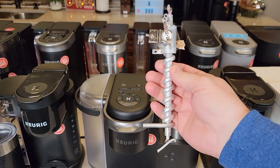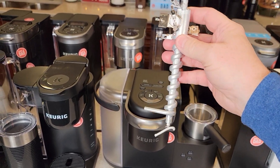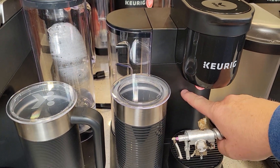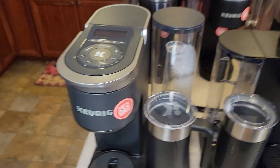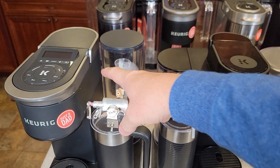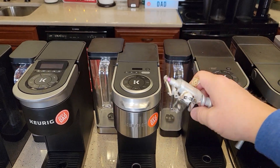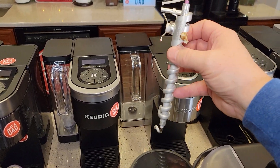I've opened up every single Keurig. The newer ones have a flow-through heating element — whenever you brew, it runs water through the element each time with no water tank stored inside. The older K Cafe actually has a tank inside that keeps water hot. When descaling these newer ones, they can overheat during the long descale process. There is a thermostat that can be reset if needed. The K Supremes were the first with this heating element — they have no stored water but brew very fast because of it.